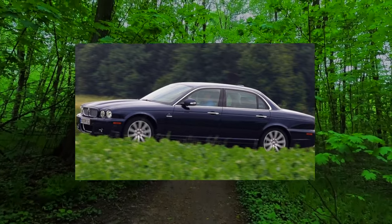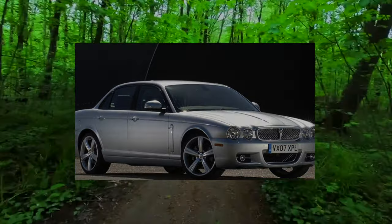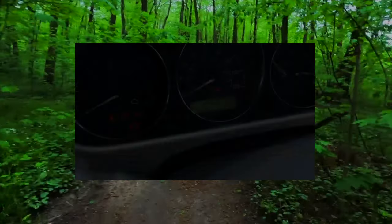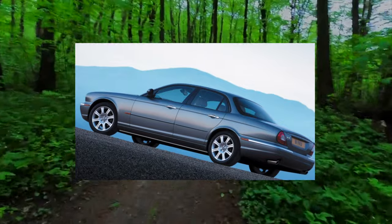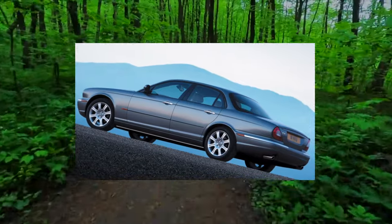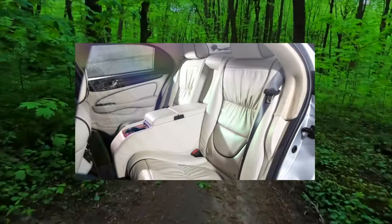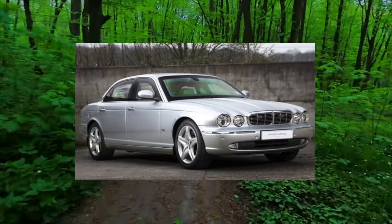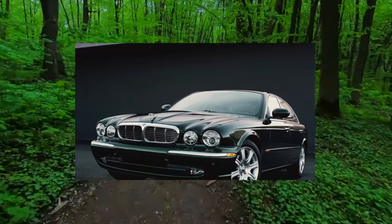All exterior panels are aluminum, and the factory paint quality is something Audi would envy. The technology using only aluminum profiles and fasteners lets you forget about aluminum corrosion — a little chromium and the difference in alloys do not affect it. The body does not rot if there is no contact with the ground, even if the cavities are clogged with dirt and the car has been standing under a tree for a long time. Chrome becomes cloudy and moss spoils handles and moldings, but the body is intact with no gray oxides. Problems can happen due to unsuccessful repairs, but unfortunately this is the price for working with aluminum.